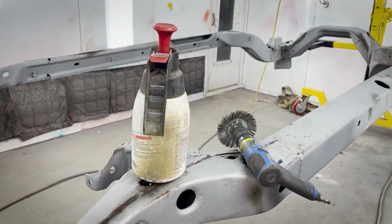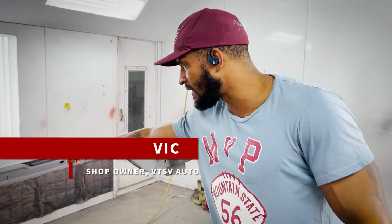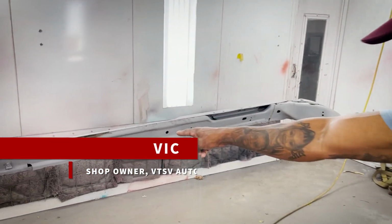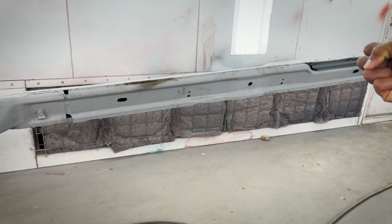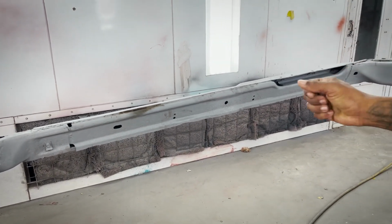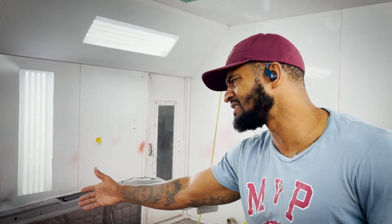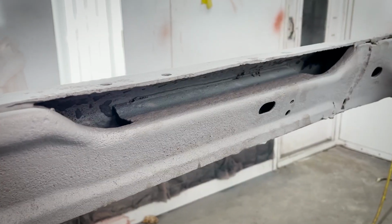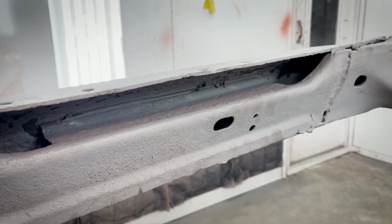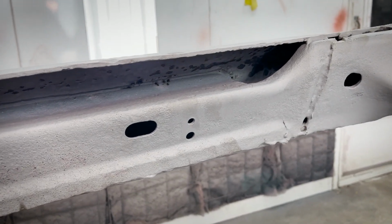Once you get it stripped to the metal, you got to protect the metal because this is raw metal. And what I mean by raw metal, if you look right here, those are fingerprints from us grabbing it yesterday. That's the moisture in our fingers. If you leave that, it'll continue and then that'll be a rust bubble. Obviously it's not gonna happen in 2 weeks, but it might happen in 2 years, 2 months. If somebody gets out of their car 9 months later and they see it flaking up and bubbling, that's because